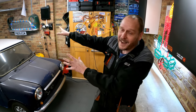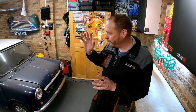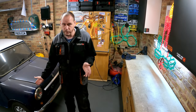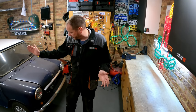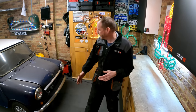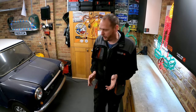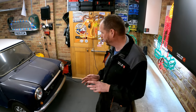So cutting it out is going to be really simple. In the past, I've measured up very, very carefully, but I'm not going to do that on Bruce because it's had this wing replaced in the past. There's a massive panel gap up by the scuttle panel. It doesn't fit to the inner wing properly. I think the near side wing is probably original. So I'm not sure what is straight and what's not straight, to be honest. So I think we'll just get it all off and then straighten up all the new panels.